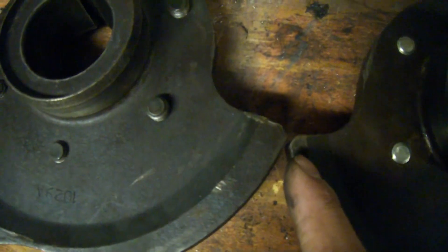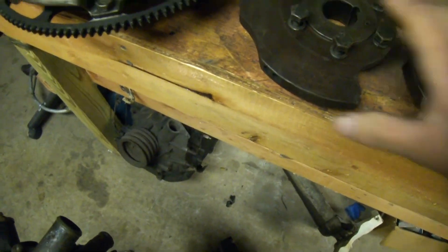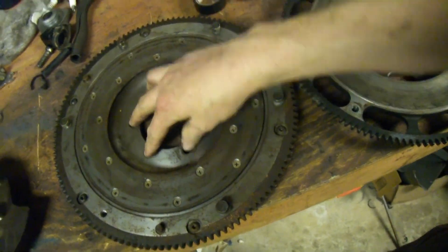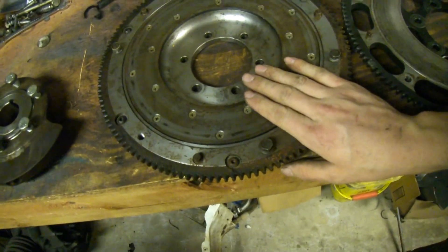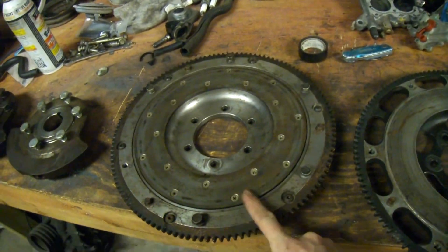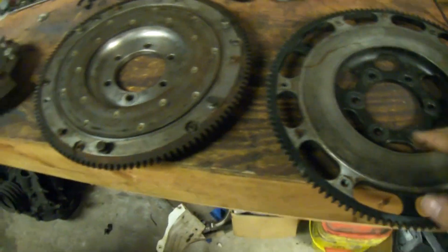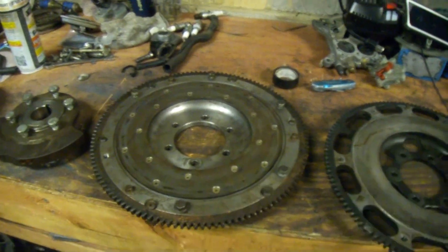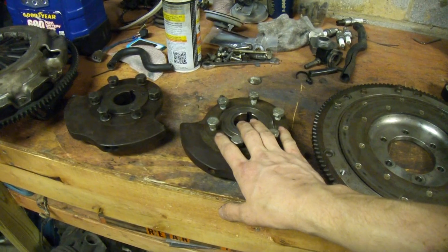You can see this one is obviously thinner than that one. From the front they generally look similar, but if you hop on Mazda Tricks' website there's a guide for determining which counterweight you have. With this counterweight you have six bolts, which means you can take any standard balanced six-bolt flywheel and bolt it right on — this one's for an RX-8, this is for a turbo 2, a nine-pound flywheel. You can get them from Racing Beat with a replaceable pad, or a solid Fidanza one off eBay. Get the right diameter flywheel, bolt it to the counterweight, then stick it on the back of the motor and tighten it down.